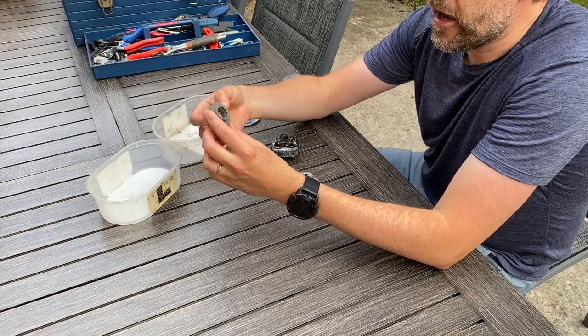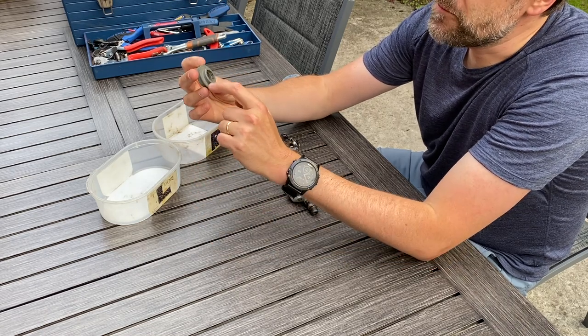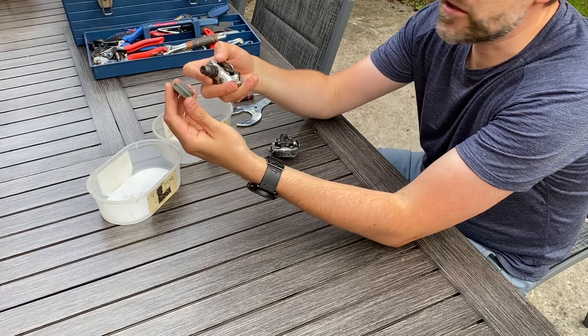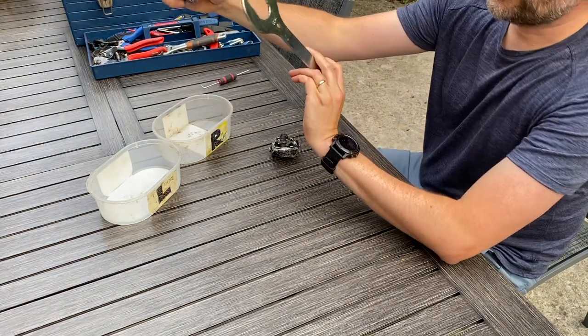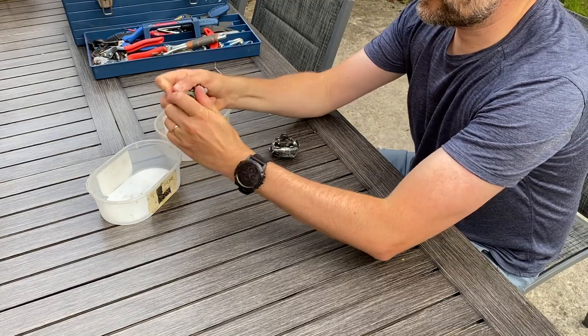This is the tool that came with them - I've had this one since new and it's very, very useful. In fact, I won't be able to do this without it. It's also marked left and right for which way you loosen the body, which is very useful because they're not threaded the way you'd expect them to be. I've already loosened it earlier using a headset spanner and now I should be able to just remove the spindle body.